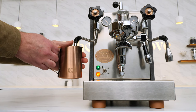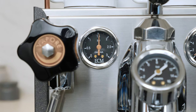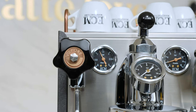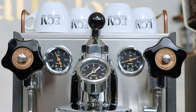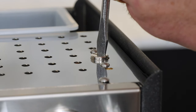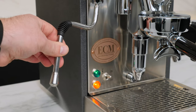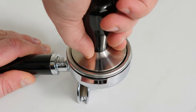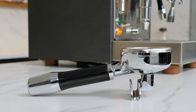That big boiler means better thermal characteristics and steam that won't quit. You can really crank up that steam all the way to 1.6 bar pressure at the high temperature setting. Individual gauges monitor steam and brew pressure, and brew pressure is externally adjustable by turning the OPV adjustment located under the cup tray. The insulated steam and hot water wands are no burn. The machine comes with a real tamper, and the single and double spout portafilters are angled.